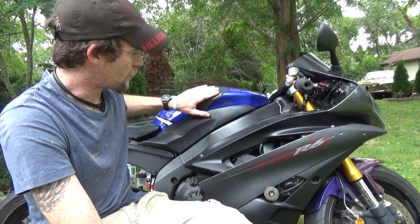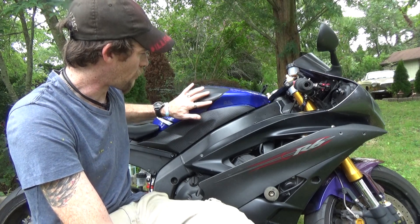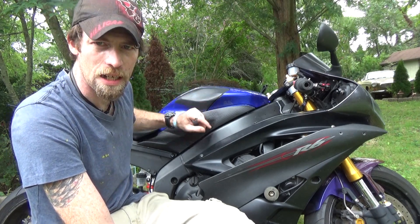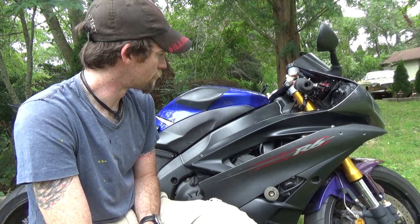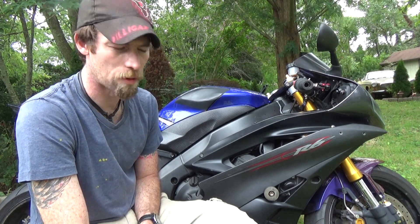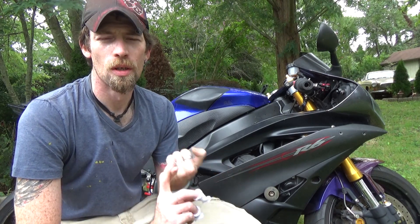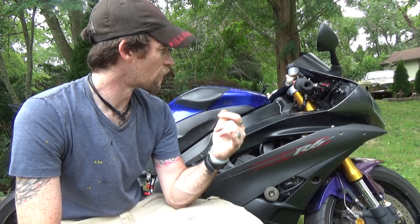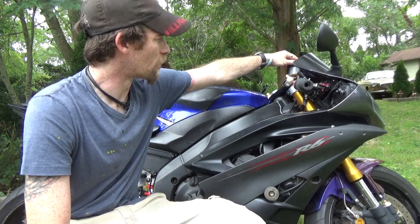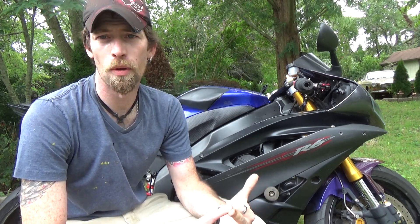The tank did get a little ding - that's why you see this black right here. Somebody obviously tried repairing it, didn't do a great job with the sanding, did a little paint work - it's not wonderful, but I'll address that. I'll do a full service on it - drain and refill, rebleed the brake system because I don't know how long this brake fluid's been in there and it looks a little funky. I'd rather be safe than sorry. I'll do an oil change and a tune-up with all new spark plugs.